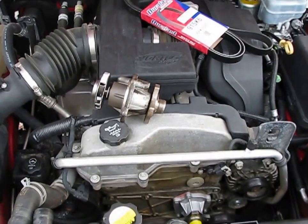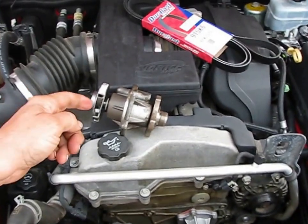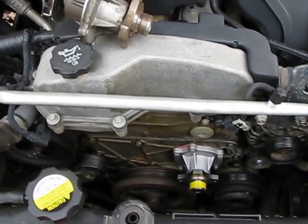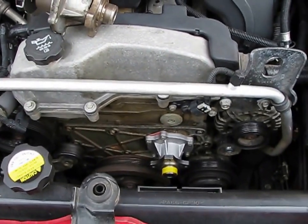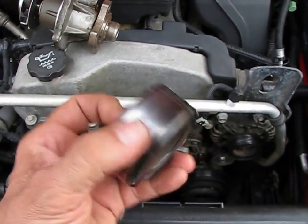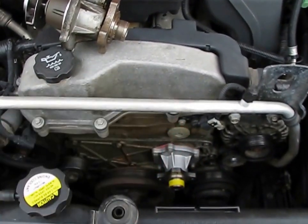It's a robust little engine with a good track record. If this is your primary bug-out vehicle though, and you lose a water pump like I did, you're shut down and not going anywhere. I've already got the new water pump installed, and since I was in there, I decided to go ahead and replace the idler — the bearings are just beginning to go bad in it.